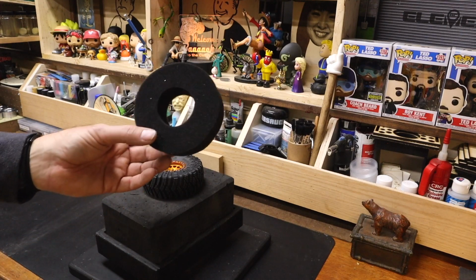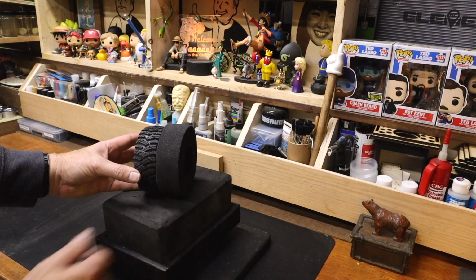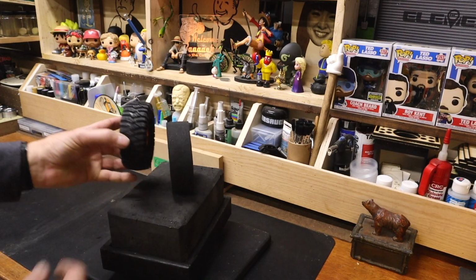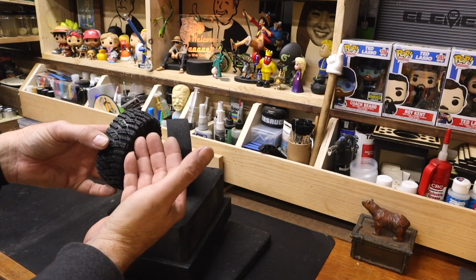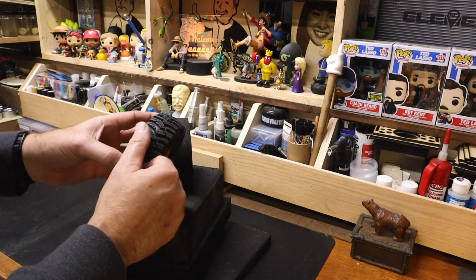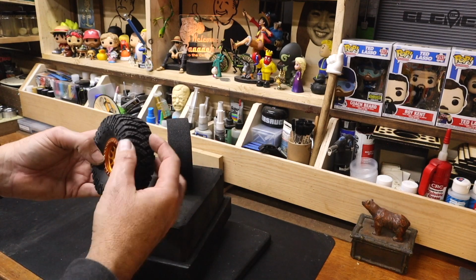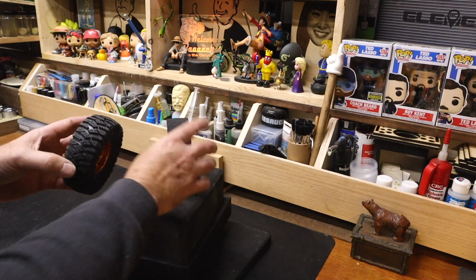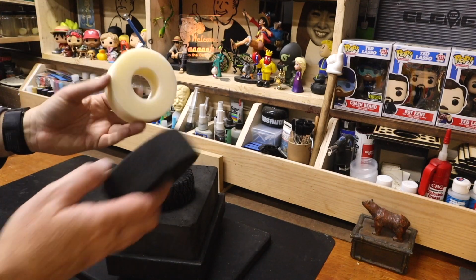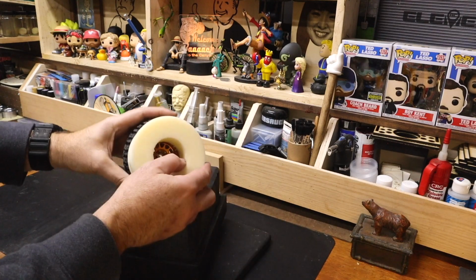So we did the old heat gun trick. The foam should not be 10 millimeters taller than the tire. Because you got to remember, we've got about probably 10 millimeters of tread. Then we have the thickness of the carcass, 1.8 millimeters in this case, which is thick. And it's uniform. The sidewall and the tread belt are about the same thickness. So this insert should actually be a little smaller than this insert. So this is a little overstuffed in here.